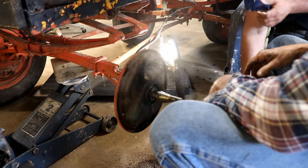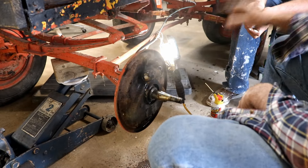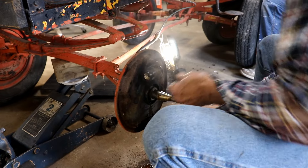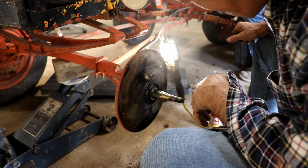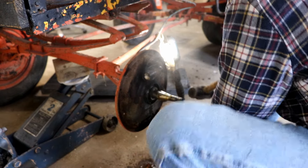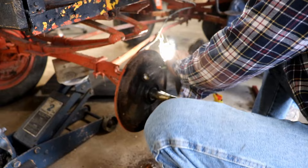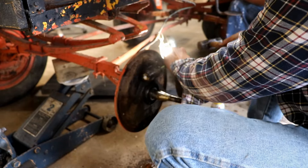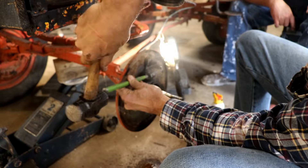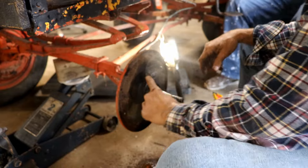I'm afraid, but press on those brakes lightly — don't go crazy on them. Nothing. We're pushing on the brake to see if the wheel cylinder moves at all. They're moving when I'm tapping on them here. It ain't moving real good but it's moving. Yep, it's moving. Like I said, this ain't the way to do it, but it's the way we're doing it.